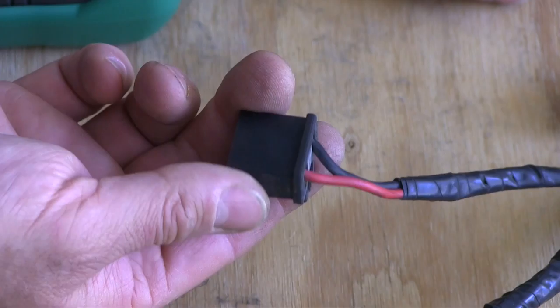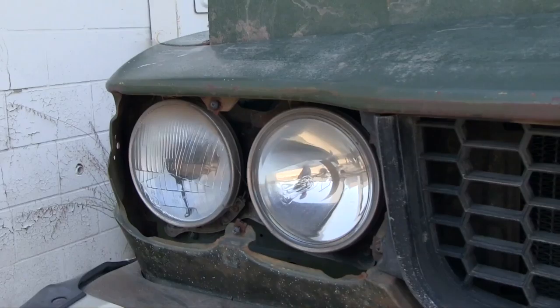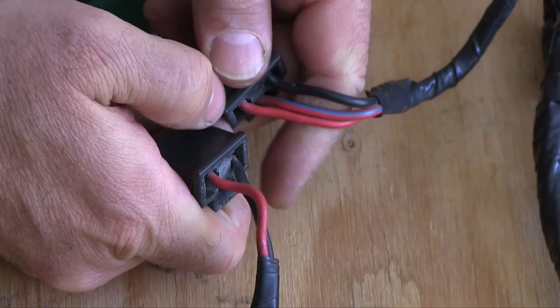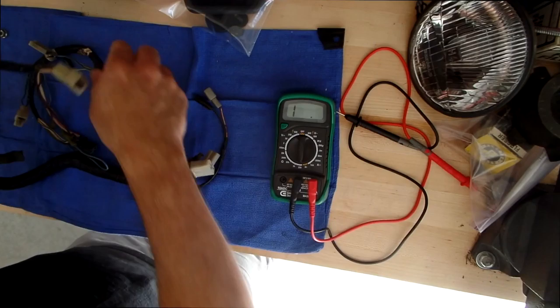While testing these wires, I'm noting that the wires going to the high beams are a fairly heavy gauge — I like that. That's got to be 14 gauge, might even be 12. When I set my green car up with the aircraft landing lights, those puppies are 250 watts of pop, and I was concerned the wires going to the headlamps would be too small. It's nice to see these big buff wires — that tells me the relay will probably be buff enough to keep in the loop. In the green car I used a Ford starter relay and direct 12-gauge wire. More on that later when we do headlights.